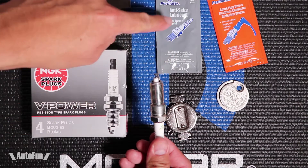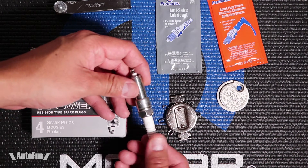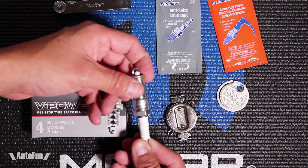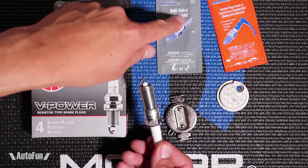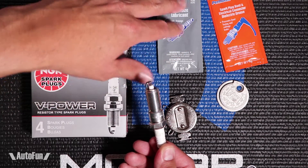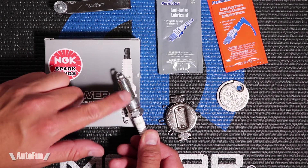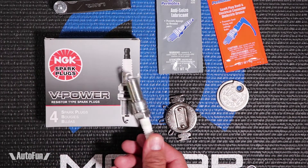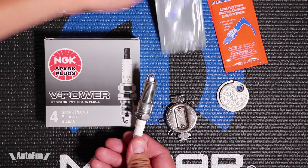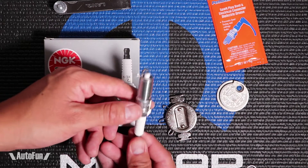The other reason I don't use anti-seize lubricant is that if there is too much on here, it will start to gum up and potentially act the opposite — it will cause the spark plug to seize because now you've got a lot of gunk caught up in the anti-seize material. If anybody is using this, the recommendation has been to always use as little as possible. I love that the NGK spark plugs have a special plating that they describe as anti-seize, so they actually recommend that no anti-seize should be used, and that's exactly how I put them in my engine. I've been swapping them out without any issue.